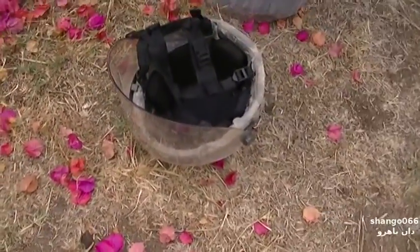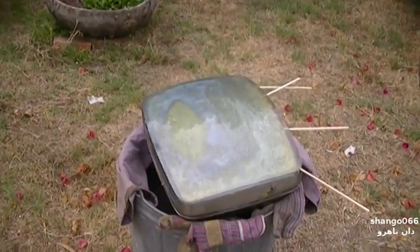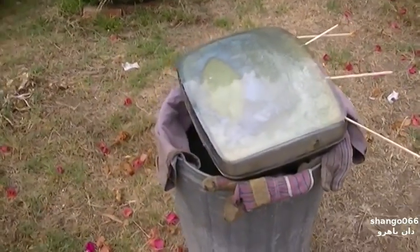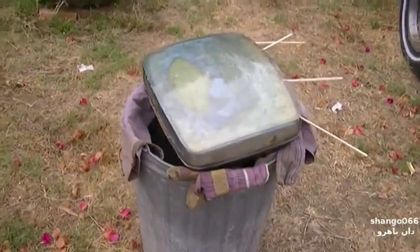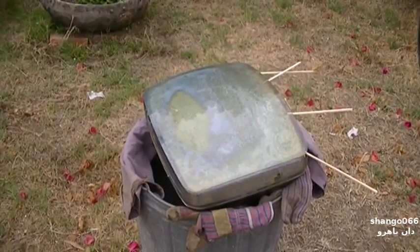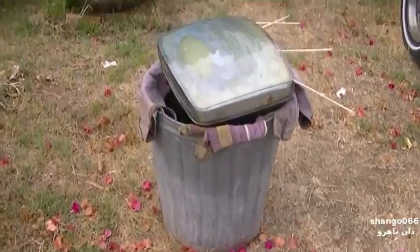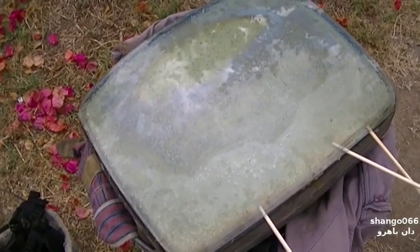I am wearing my riot helmet face shield and staying away from it. I should probably have more safety equipment on because these are not like the round ones — the pressure is uneven. They're not a circle, so the longer side has more pressure. When they don't have a band on them they can explode, and there are more records of the rectangular ones exploding than the round ones. If you're doing a rectangular CRT, you really have to take precautions.